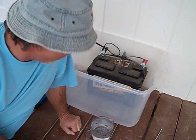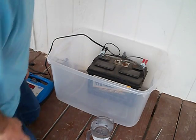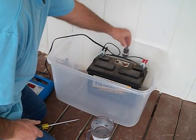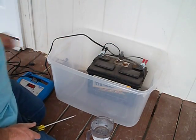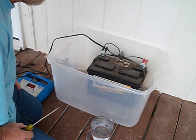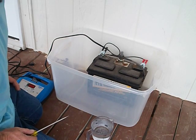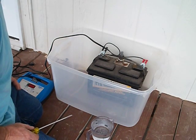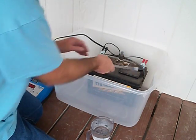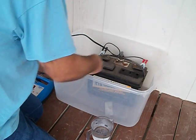What I've got here is a deep cell battery. This charger is designed for that. You're going to need a battery post cleaner — I've already cleaned the post. I've got this thing already hooked up, all I have to do is plug it up. When I did plug it up it showed 5.1, so this is a pretty dead battery. You need a flathead screwdriver to come in here and pop these tops off and just get them out of the way.